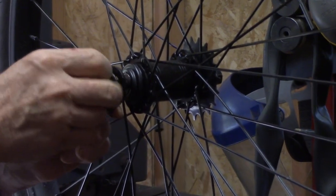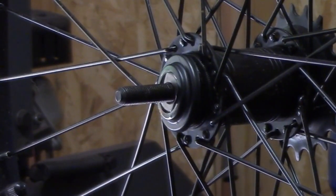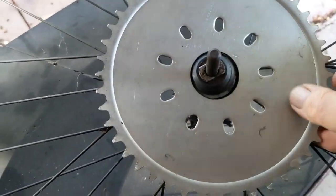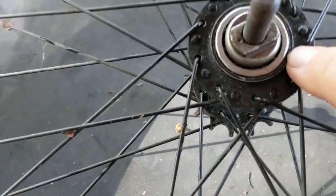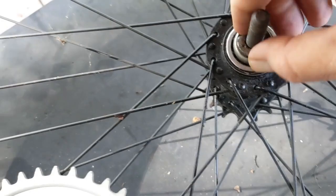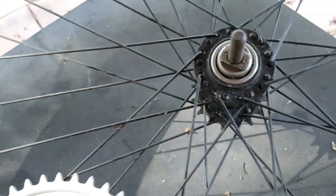Once you get the brake arm off, you'll see that little thing called the dust cap. That dust cap has caused quite a few motorized bicycle enthusiasts a lot of heartache. See how this dust cap is behind the sprocket? Because the next step is installing the sprocket - and little problem: if you don't trim down your dust cap, it's going to press against this little flange here and the wheel won't want to turn. Everything's going to be in a bind.